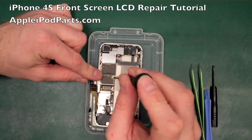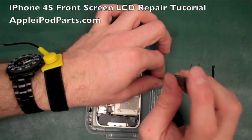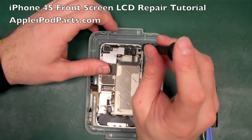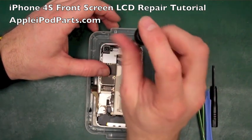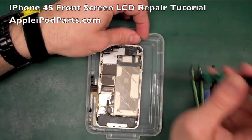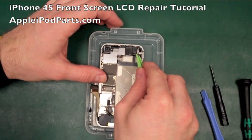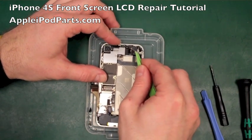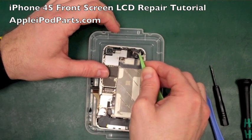And then also we'll take the screw out of the board, the main board as well, and we'll put that over here because that's on the right hand side of the board. It's a case of pretty much removing stuff as we go. This little screw here holds the bracket down. Tiny screw that goes up there, and this bracket lifts up. And all it is, this is just like a retaining bracket for a little circular aerial connector. That lifts up there and drops back in there.